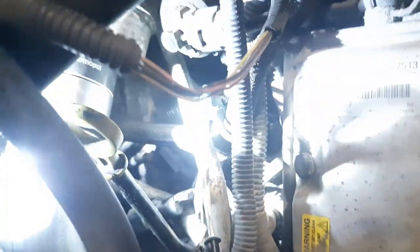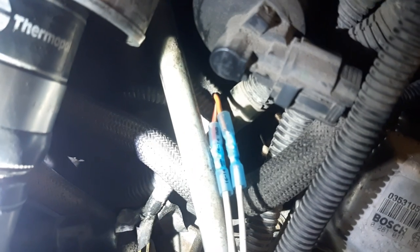The kit provides a couple of heat-shrink butt connectors. I left the wire about four inches long to give myself a little room to wrap it back into place. This one is a real pain — it's really hard to even get the wire stripper in there. I think probably all of the passenger-side bank except maybe number seven back there are a pain because the others are right behind the fuel filter. Number two is right here behind the battery terminal post.